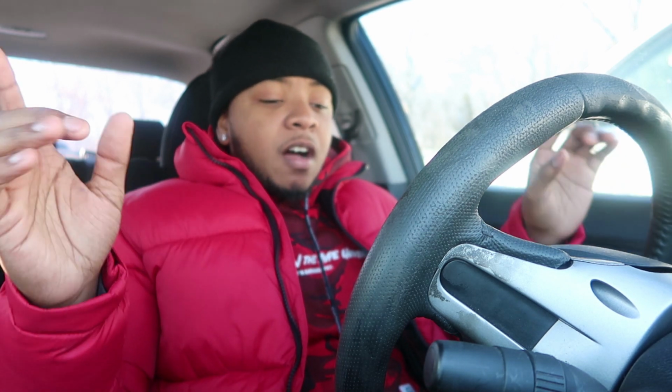But I'm gonna go get something to drink from the gas station. I'm on my lunch break, but as you guys know, the exhaust is now installed on the car, which is a Skunk 2 70mm exhaust. I have the full exhaust. So we had to do some modifications to the exhaust so that way I could run my airbag on the driver's side in the back. Because when you air out, or just the bag in general, is really, really close to the exhaust. So now that I have that mod, it has a lot of clearance, as you guys see, so I'm good.